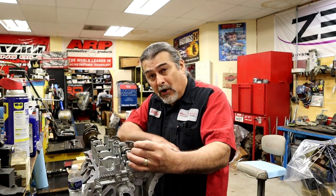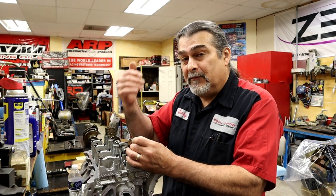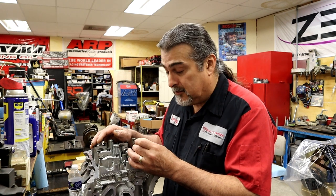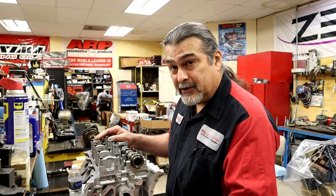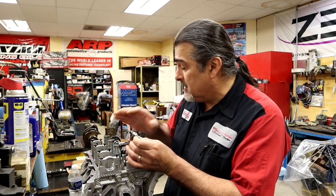In further inspection the cylinder head came in. We pulled the cam off, pulled vacuum on the exhaust and intake ports — they pulled fine. The technician did a leak down test and had like two to three percent leak down, so he knew it wasn't the valves but couldn't figure out what it could have been. The head comes in, we pull it all apart, pull the springs out, check valve heights — they're okay, slightly on the higher side but within spec. Going back and forth with the factory rockers versus the Amazon ones, there was still an issue.